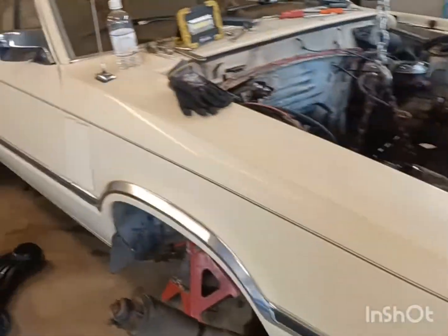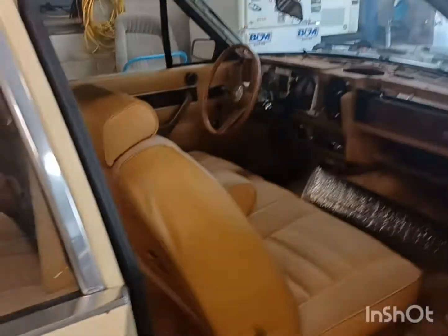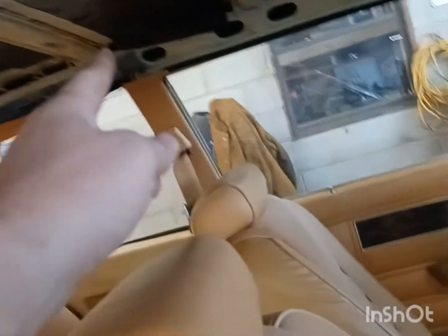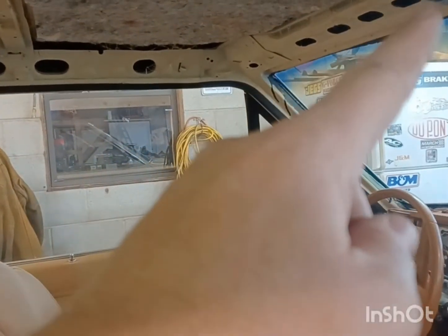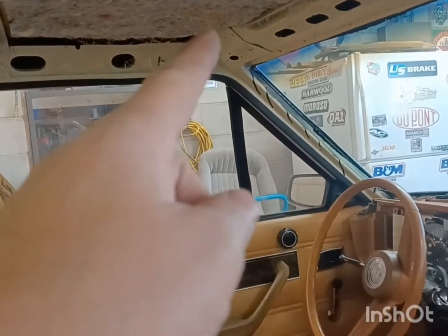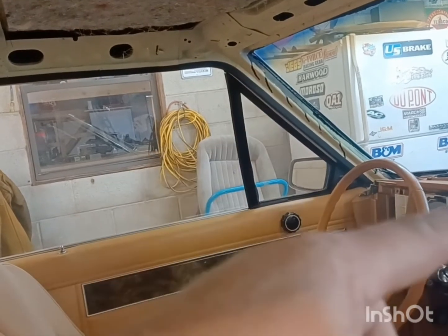Well, it started out with the headliner. I haven't got it to the upholstery shop yet and I haven't got the dash tore out, but I do have the headliner out. It's pretty simple and straightforward — you just pull most of the trim down along the edge. They're not like a Fox body; they just all screw up really easy. There's no clips along the front, they just hold screws, so it comes down really easy. You also have to move the A-pillar covers and the dash cover.